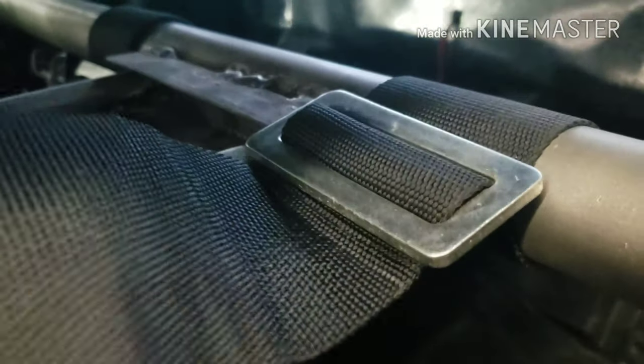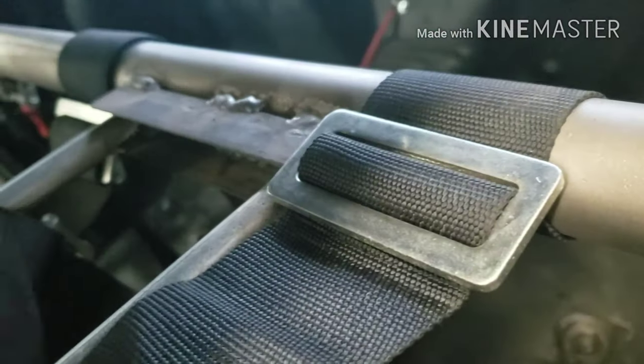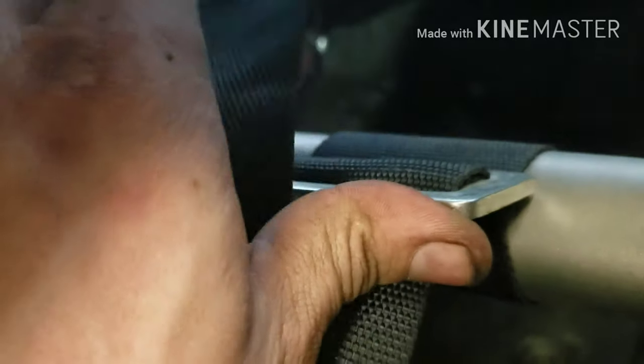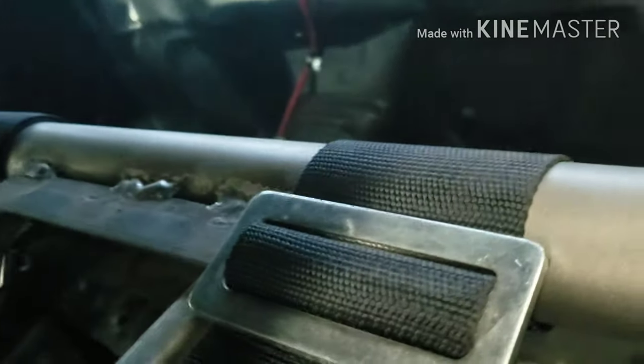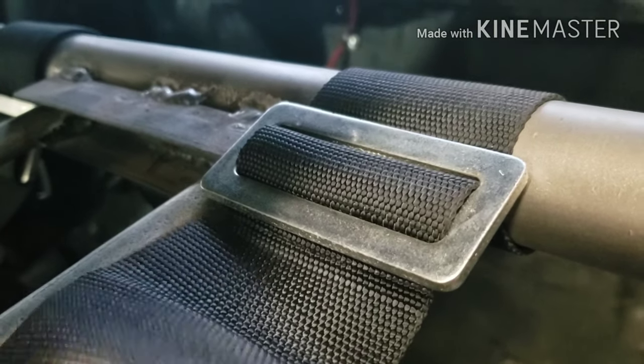It's a bit of a pain but I got it out. As you can see, if we lift this up, both of these go around the bar and through there — the top and the bottom one — and that's where you get your three passes. The bottom one goes through, around the bar, and back through for a second pass. The third pass is taking it half through that way, like I just pulled it out. Three passes through there — those things will not come undone, doesn't matter what vibration you're putting through the car. Nothing moved in two years, but it's time to change them.